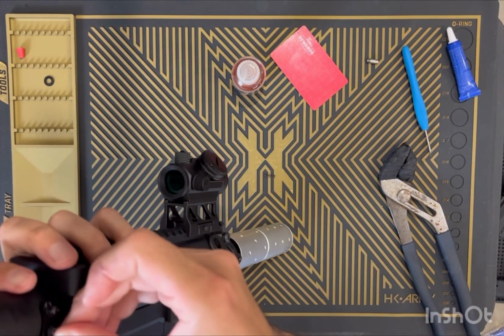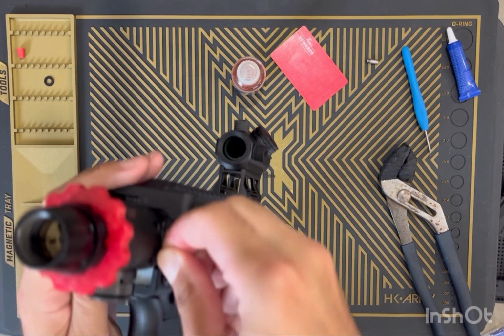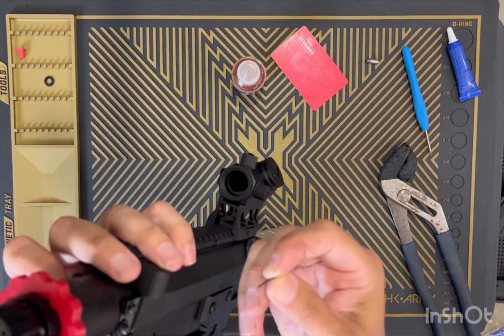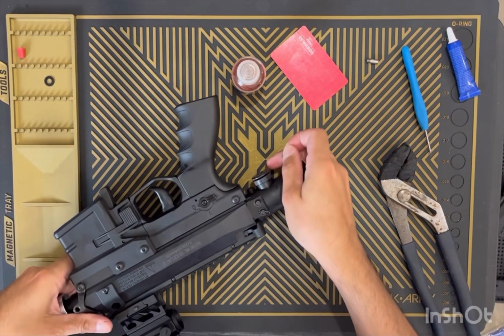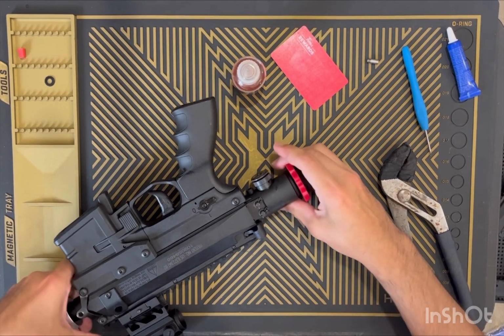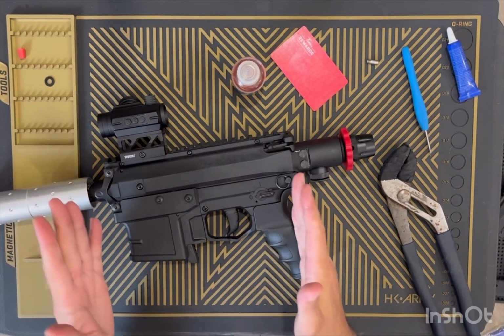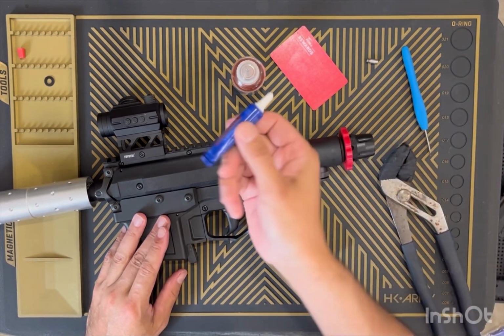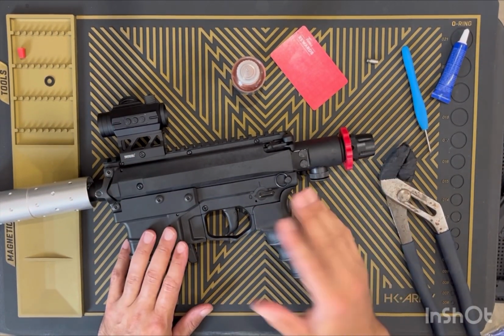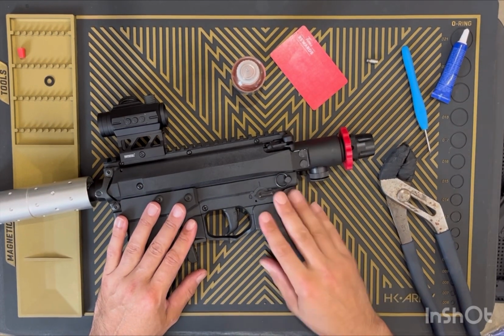Forget your washer. Rotate that pin so the hole is where I can reach it. And voila, little minor preventive maintenance goes a long way. So that Loctite, it's got to set for 24 hours, guys. So once you do that, set your marker aside for 24, and after that, away you go. All right, hope it was helpful.